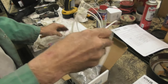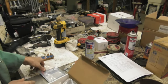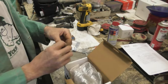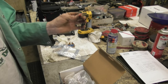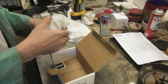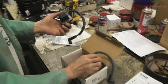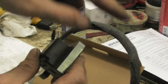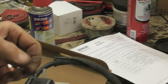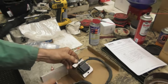Pretty simple kit. This is your new kill wire. These are some zip ties. They give you a couple of connectors - in case you have a bullet connector you might have to cut it off and add this connector. And then two new coils. Now I've read through the instructions and nowhere does it mention this wire, which is like a bleed-off wire - it's hooked into this. So you hook that here when you go to put the new coils on, but they don't even mention this wire - they must have forgot about it. And then they give you a sticker.